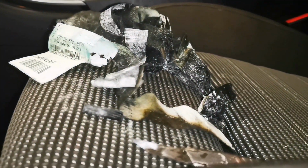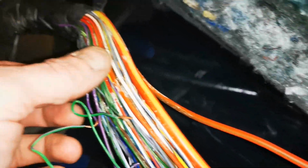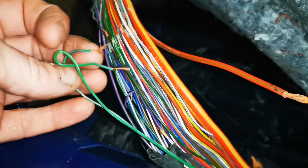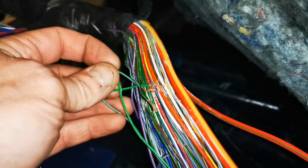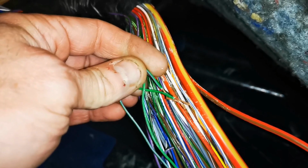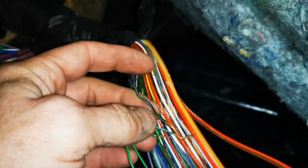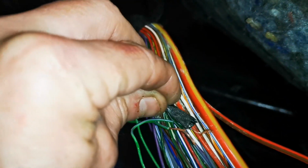So, broken wires under here. So I've stripped a lot of this. I'll carry on here, and I'll take it down here. So what's going on here is these green wires here. That's our LIN signal, and that's the two rear windows there. So when I came to this, these come around like that, and the way I found that was there was just no connection at all. There was this wee bit of tape over the ends there.